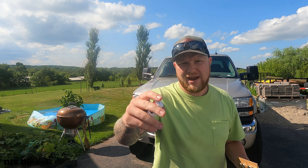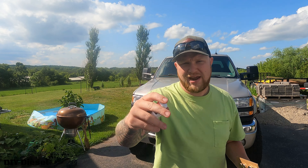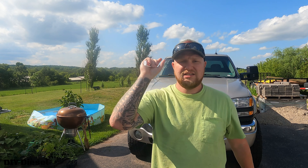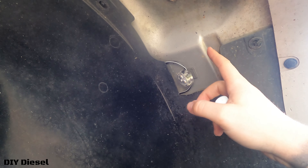The rock lights did fail where I thought they would fail, and they only failed at the point where the 3M sticky was sticking to other 3M sticky. If I didn't have to stick 3M to 3M, it would have been perfectly fine, because the actual 3M is still sticking to the LED itself and to the truck.